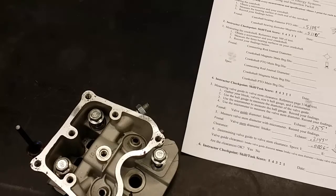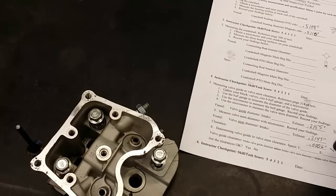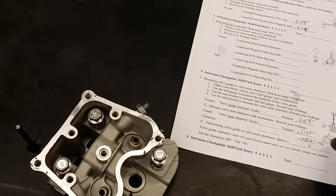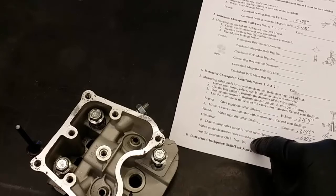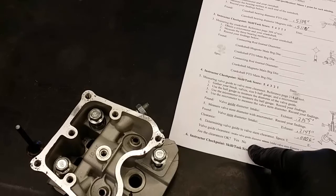Most of these engines are a little bit closer to one thousandths or so; some I've seen up to two thousandths. Anyway, that's the process we're going to use to measure valve guide clearance — the same process would be used on the intake. Once you've got your measurements, you need to do a little bit of math to figure out the actual clearance, which tells you how much room there is for oil to lubricate those two parts. We'll compare them to specifications, and for your checkpoint don't forget to have the answer as to whether your clearances are okay or not. We'll talk about what to do if they're not okay in another video.